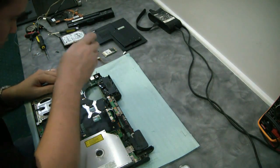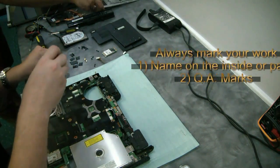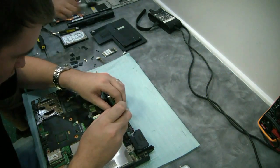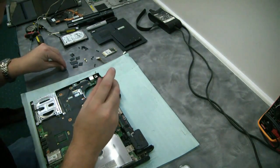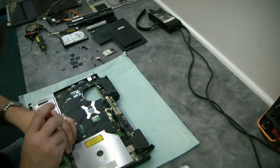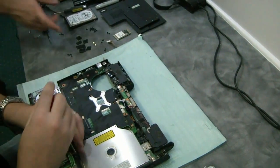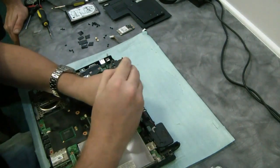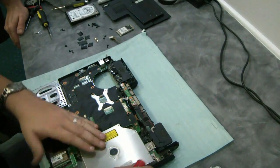If you run a shop or you repair your own stuff and have a lot of laptops you work on, always initial or put the customer's name on the actual unit you're repairing. That way you don't switch a hard drive on somebody — that's standard practice here. Dell does a really nice job of shielding everything. Dell actually shields the whole top piece, which is a great practice — if you have something spill through the keyboard, it doesn't spill all over the motherboard.